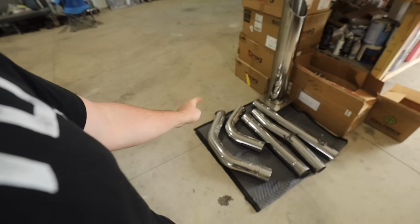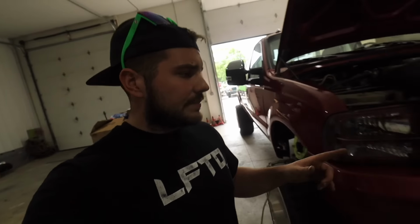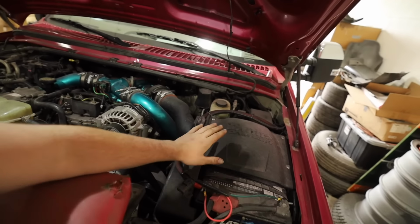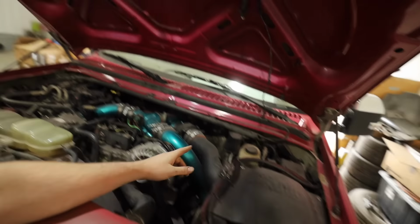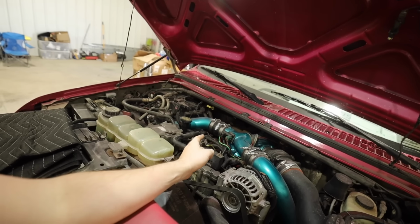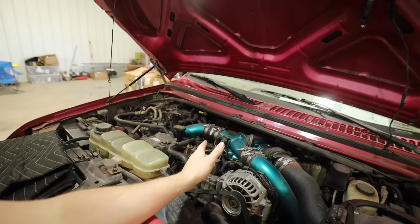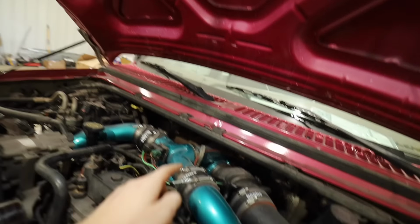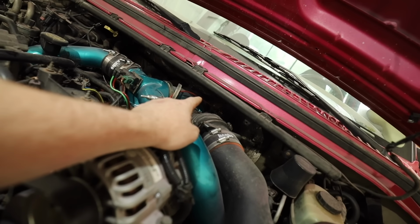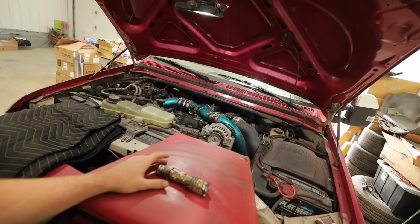And also here, this is a different downpipe than usual because under the hood, Banks Power massive intercooler, bigger boost tubes. We've got the Banks Ram Air cold air intake, turbo rebuilt, new exhaust housing, new exhaust elbow. Obviously more flow coming out of the turbo, wicked wheel in there. Back in there, everything's a little dirty. Gigantic wastegate on this guy, and all of that. So we kind of went through this and put this all together already.